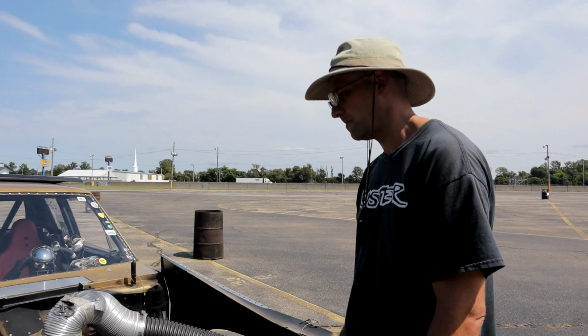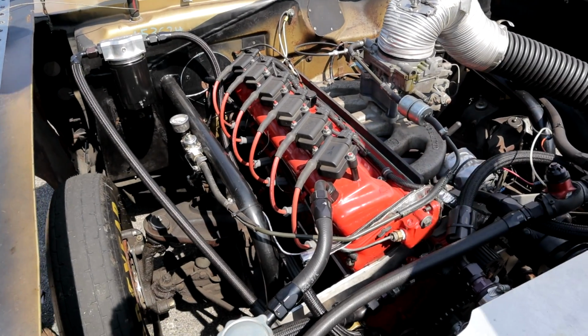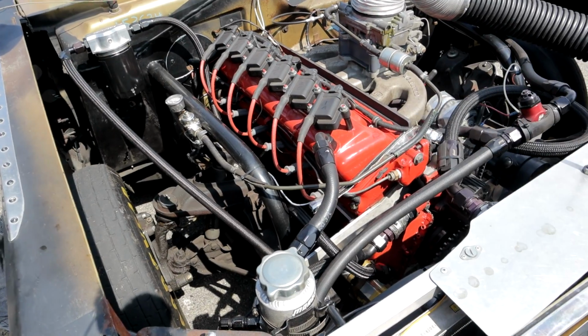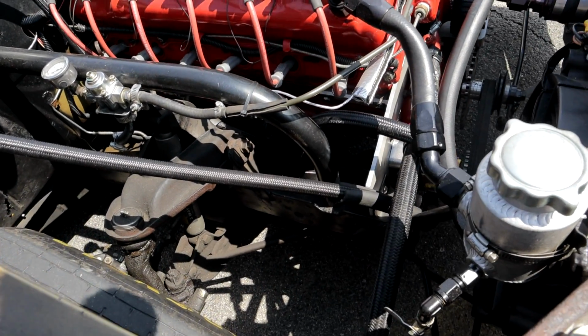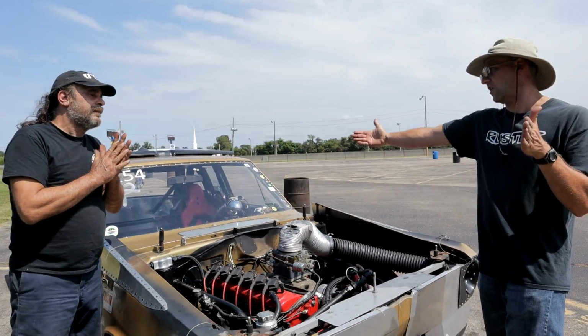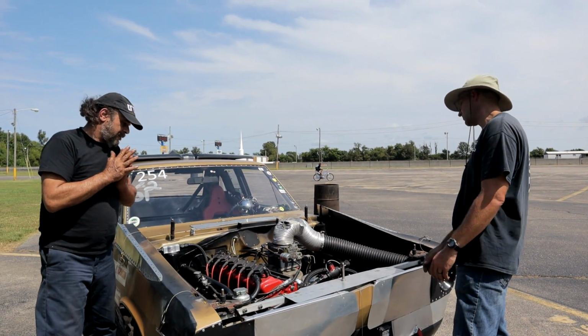So you don't have an oil pump here either. You've got a dry sump. It's not a dry sump. It's an external wet sump. There's quite a bit of work done to the oil pan. There's trap doors and baffling. It's not a road race pan, but it has trap doors so that when you leave off the brake or light at the starting line, the oil cannot slosh back. It keeps the pickup covered. It'll hold 10 quarts of oil.